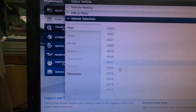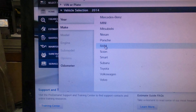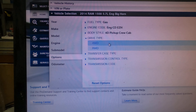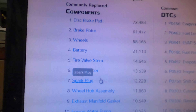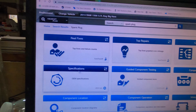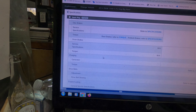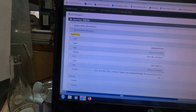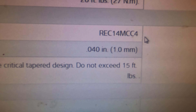I'm going to show you guys one way - you can go to any kind of website. For instance, we use Pro Demand. You enter in all the information: year - we have a 2014. We have a Dodge RAM 1500 with the 5.7, Big Horn, Pickup, Crew Cab, four-wheel drive. Click Use This Vehicle. It gives us all the information, so we go to number seven which is Spark Plug. We click on Spark Plug and it gives us all the OEM specifications. We go into OEM Specifications, scroll down to Spark Plug. The 5.7 says that the correct gap will be 0.040 inch or 1 millimeter.